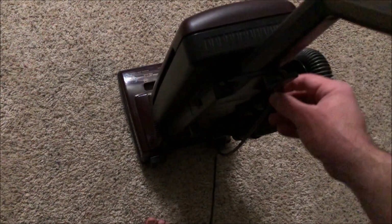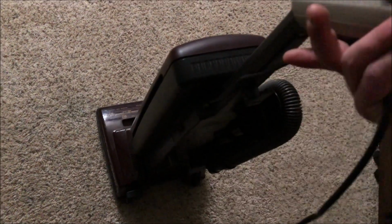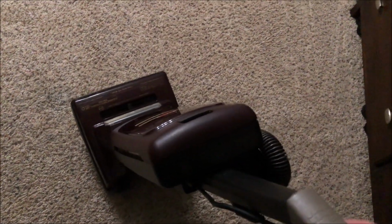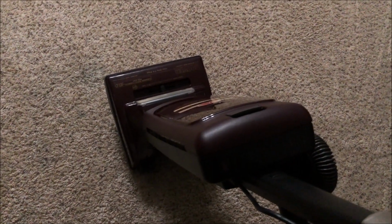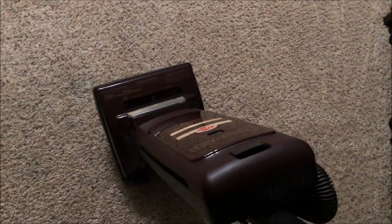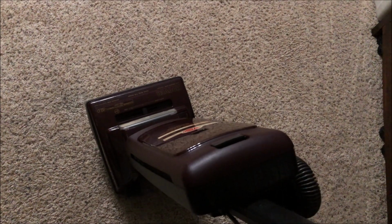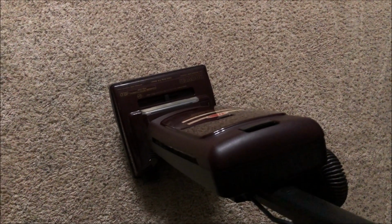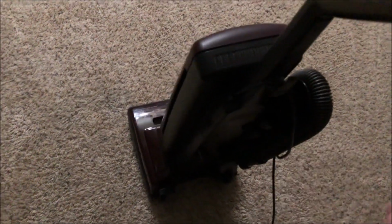But a washer was completely missing when I went to tear it apart, and the fan was riding so close that it was rubbing against the motor housing and causing the motor to run very hot. I'm surprised it didn't get hot enough to the point that it almost melted itself to the motor housing, and that would have been a very bad day. But somehow, by the grace of God, he spared this thing.